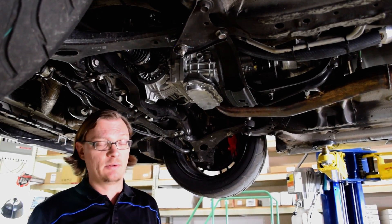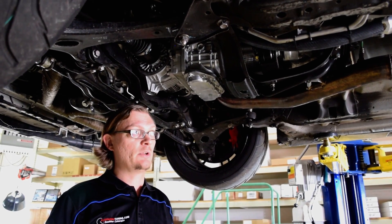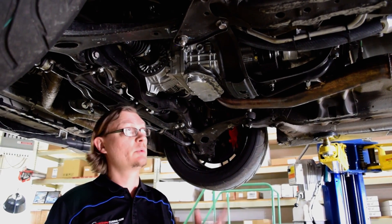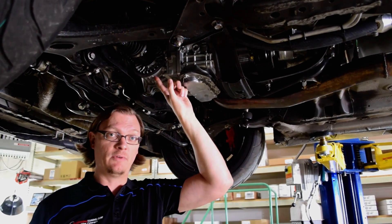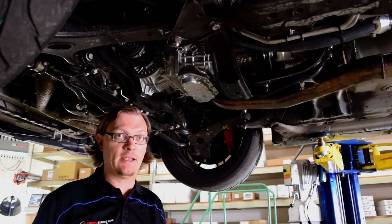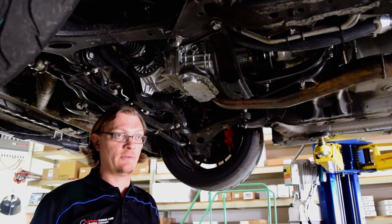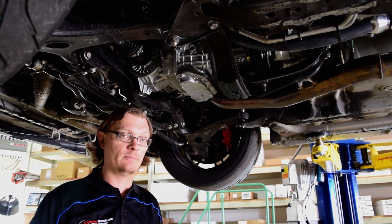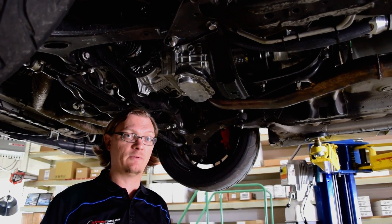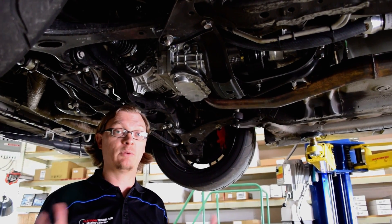The next question we get asked quite a bit about is axles. It turns out that the WRX axles will snap right into the STI transmission, so the front axles are just WRX front axles. That is pretty much true for most years, except for the earlier WRXs. We'll do another video on our 2004 WRX rally car that also has a 6-speed swap. Long story short, you don't have to worry about the axles.